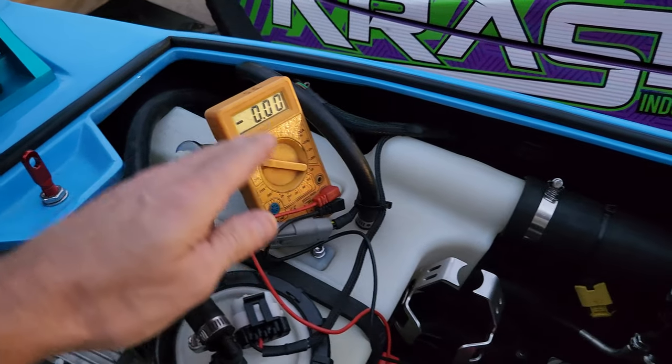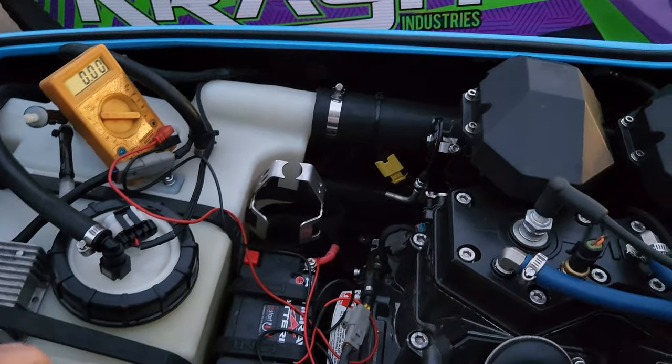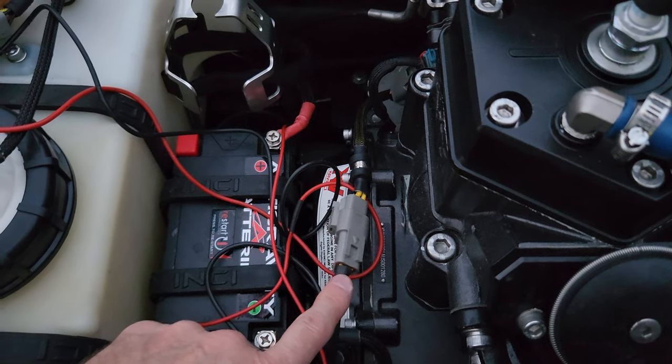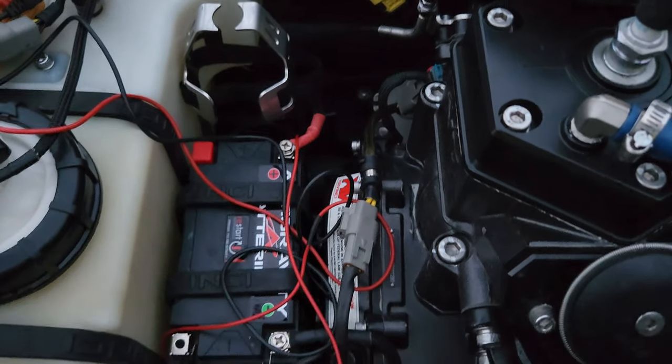And that's it. As you saw, it started to raise the voltage back up and that's what we wanted, so we know we have a good charging system in here. Now if any of your components are bad, the stator can be tested individually with the coils, and if you've ever had a broken Bendix fly around down in here it can obviously knock out a stator.